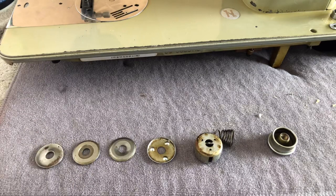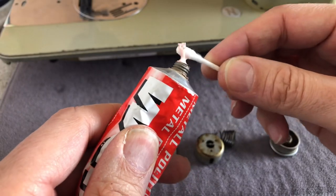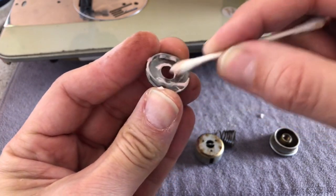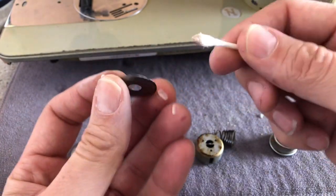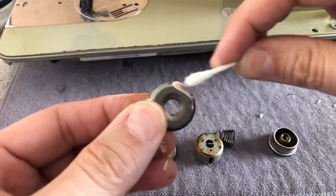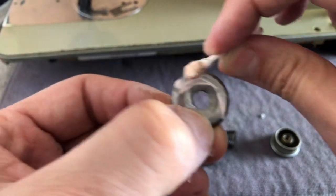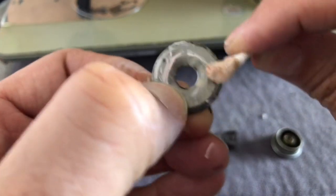Here's one example — that's the position that piece was in. Now I'm going to take this German metal polish — I just say German, it was made in Germany. It doesn't have to be this brand; I've seen polishes called Autosol and others. You don't have to use the exact polish I'm using here. Polishes have abrasives — in this particular polish it's a very fine abrasive — and they also have some level of solvent, the part that keeps the polish liquid. There may be other things; I'm sure it's a proprietary formula.